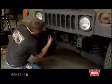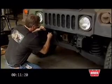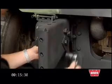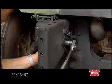Install the frame extensions using the same fasteners used to attach the vehicle's original bumper. Rotate the stiffening brackets back and bolt into place. Make sure the surfaces between the tops of the two frame extensions are relatively level — this allows for proper kit alignment. Tighten the fasteners that hold the extensions to the frame.